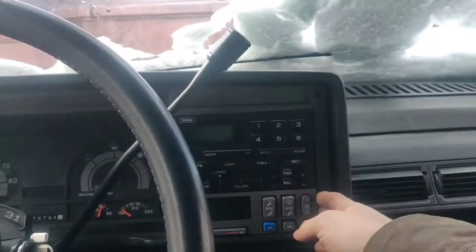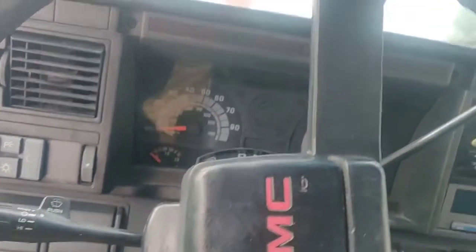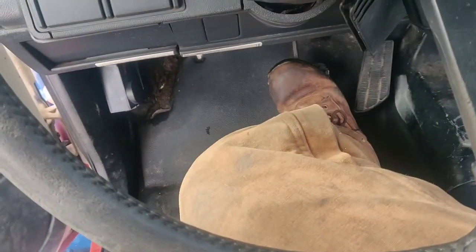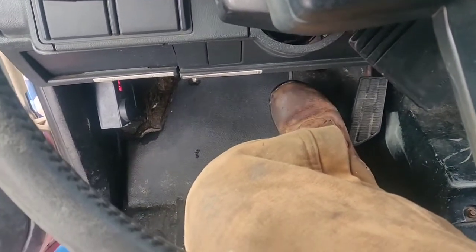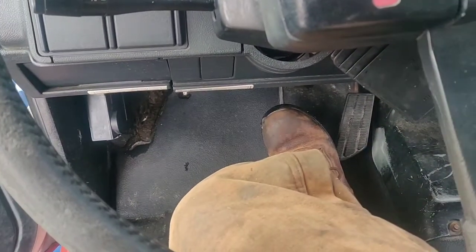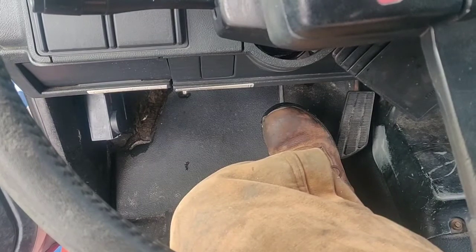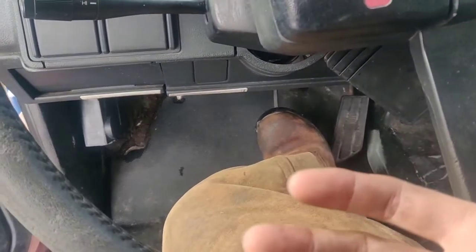Anyways, here's your controls — and this is a 2000 model, not a 2005. I did put 2005 in the video, but the difference is: on the 2005s, when you press on the brake with the engine off, your hydro boost will actually activate, so you'll have brakes even when the vehicle's off. That comes in handy — if your battery's dead and you've got to get it moved, that can help a lot.